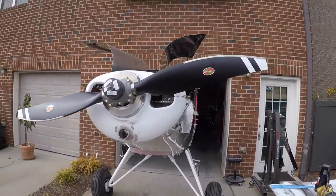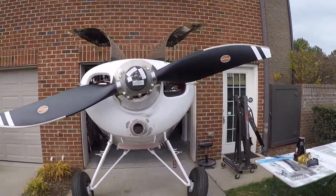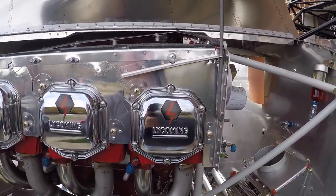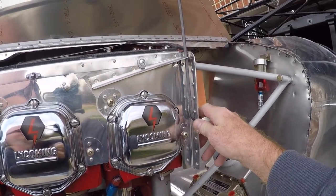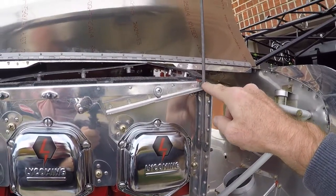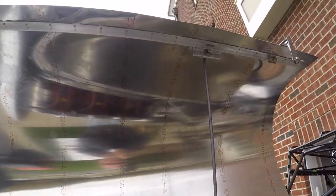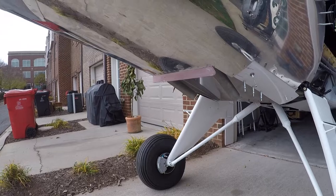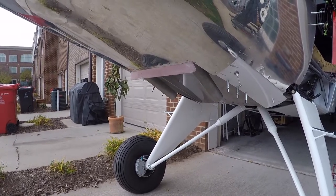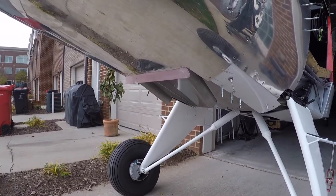The cowl doors are open - I think they look pretty cool. Both are secured with a prop rod made out of quarter-inch round steel. The baffling secures the bottom piece of the rod, and the angle kind of locks it in so it doesn't go anywhere. The top of the rod is secured with a piece of angle with a little bronze/brass bushing, and when not in use you just swing it over and latch it in. The fiberglass lip I mentioned came out pretty decent - I'll do a little more sanding to even it out, but once painted it should look really good.